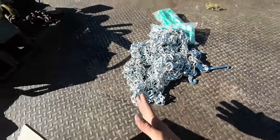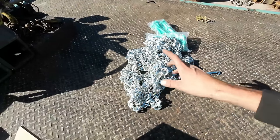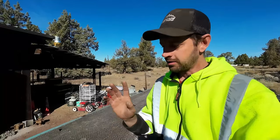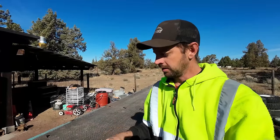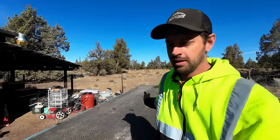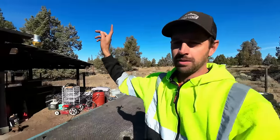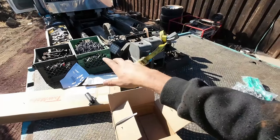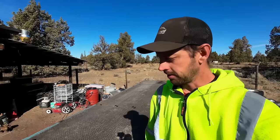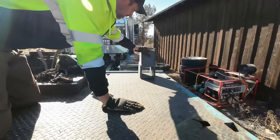This is a diamond chain that does a diamond pattern on the tire — it's a single that goes over one tire only, and the diamond pattern is a lot smoother driving down the road than the cross-link pattern. My thought is I just have one pair of these diamond pattern chains to throw on when I don't need much but need chains — I can throw them on one drive axle. When I really need nasty weather towing in big mountain stuff, I throw the big three-rail chains on. This should be pretty quick and easy for lighter weather.